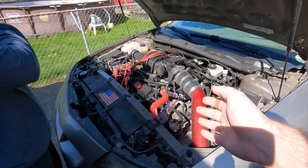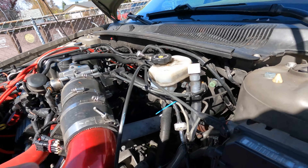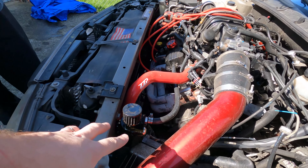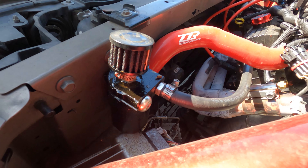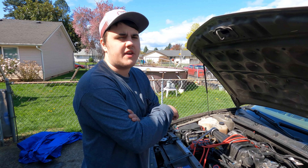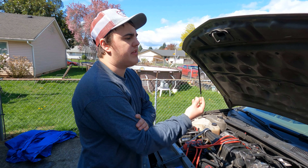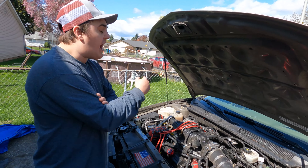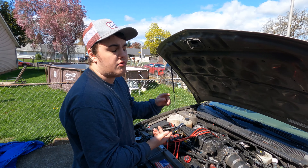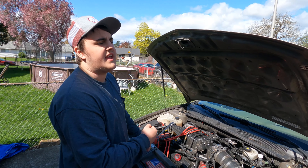Most people replacing a transmission probably wouldn't pull the full engine — we're doing that for a couple of reasons. The cylinder head on the back on this side and the other side is leaking coolant and oil, and the catch can is constantly failing — you can see how disgusting that is, it's just been spraying everywhere. We think the leaking coolant is because we never retightened the head bolts, or it could be that coolant is leaking past the threads since the head bolts go into coolant jackets.